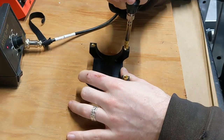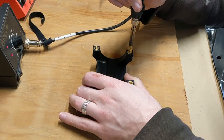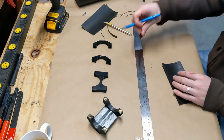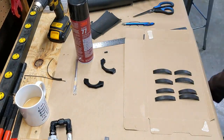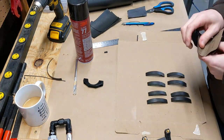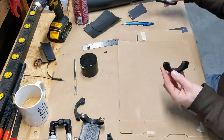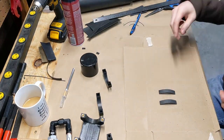Here I'm using a tool a buddy of mine let me borrow that allows you to heat-set threaded inserts into 3D prints, and it worked really, really well. For the final part of the assembly, I just wanted to add some rubber to the mount to help isolate the pump and post-filter from any vibrations on the bike. What I've used here is a drawer liner from any hardware store — about 60 thou thick — so I just layer up multiple layers, and I use some Super 77 spray adhesive to glue it to the mount.